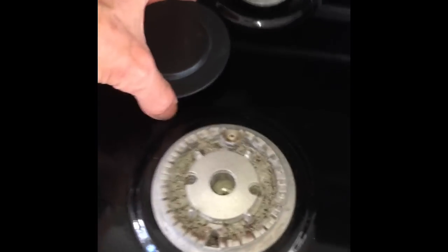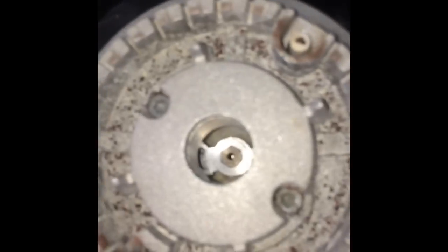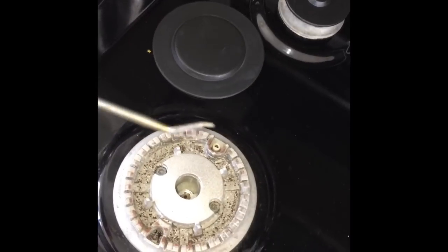You just pop off the top, look down there, and you see that little brass jet with a hole in it, and you just need something sharp. I'm using a dental pick, but a straightened out toothpick would work too. You just shove it down into the hole, and you can use a flashlight to see what you're doing, and then wiggle it around maybe five or six times to break up whatever the residue is.